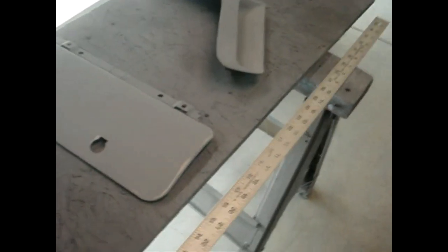Like I said, I use that one on big, long, straight panels. Use these kind. Turn them up on end. They're always pretty straight. You can always check them with a square and see. But yeah, I didn't like what was right here. Saw a couple places, so I went ahead and knocked this down a bit farther. Remember, this hood was really wavy. So I feel pretty good about it now. Like I said, I'll shoot some right in this area right here. I'll knock that down and cover that up.